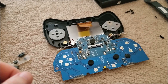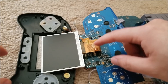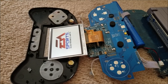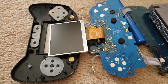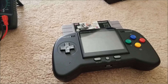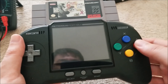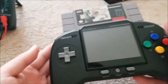I couldn't wait to get everything buttoned up — getting the connector in without taking the LCD cable out is really difficult to seat correctly. But I have it all together with a cart inserted. When reassembling, be careful that the button membranes align, because my A button wouldn't press until I reopened and realigned it. Also make sure the shoulder buttons are aligned with the little rubber pads underneath them.